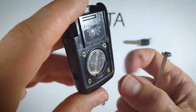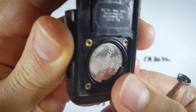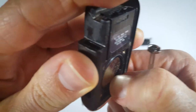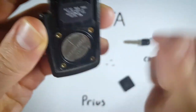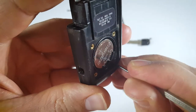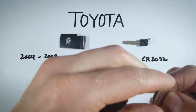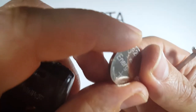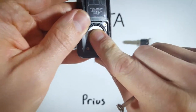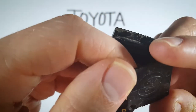From here all you need to do is push on the bottom of the battery with your finger — right where this little thing is holding it in — push with your thumbnail and it will pop out a little bit, and then you can pull it out with your finger. It might take a couple of tries; you can also use your tool, just pushing on this little bottom part and it will click out. Once you do it, it will just feel right — you'll feel it snap out and then you can pull it out with your fingers. This is a CR2032 battery; make sure that is what you're using, and when you put it in make sure the positive side is facing up. Simply slide that back in there, plus side facing up.